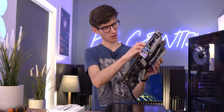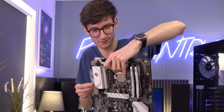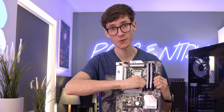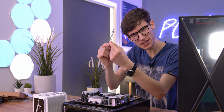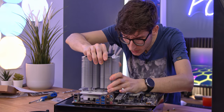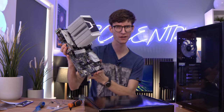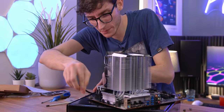Getting the instruction manual out - it's not as simple for Intel as it is for AMD. The backplate goes on, screws go in. Once you've done that, you've got these little Intel brackets that you just place on top of those posts, screw those down, add a line of thermal compound, drop your cooler into place safely and securely. Then we have our Arctic digital camo motherboard combination. Drop your fan in place, grab your cable, and plug it into where it says CPU fan.